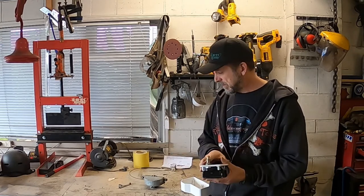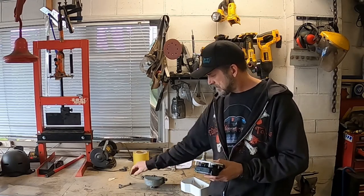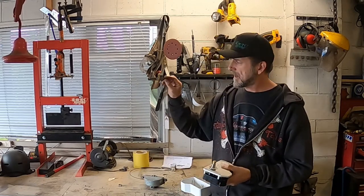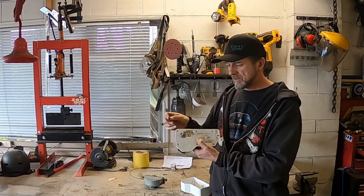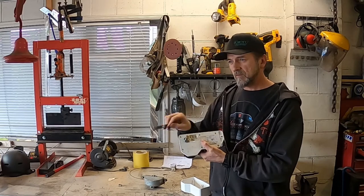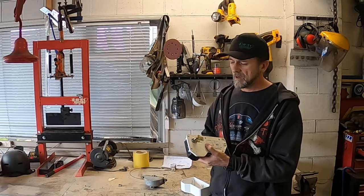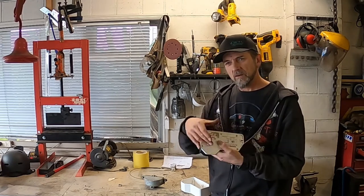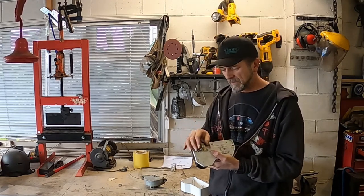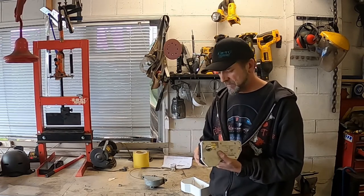But yeah, so my plan is to relocate this arm from the old wiper motor onto there, because these wipers just sweep back and forth, whereas a lot of the newer wiper motors just go round and round and round, and I need one with the gearbox that can go back and forth. And I've tested this on a battery and it just goes back and forth.